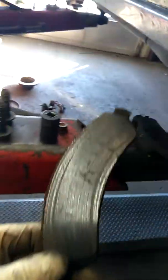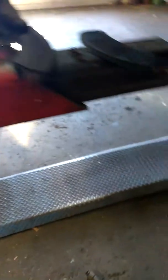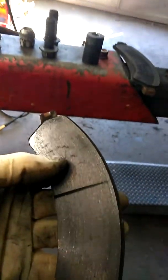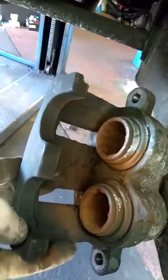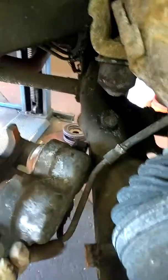We'll take it to the front brakes — I have them apart. There are pressure cracks and uneven wear. This brake pad actually still looks decent, but that's only one. You can see pressure cracks from the heat on the others. You're going to inspect the caliper — there's some rust-pitting inside the pistons. On an older vehicle like this, I expect that, as long as it moves freely and there's no signs of it hanging up.